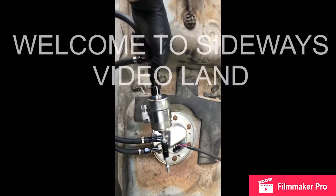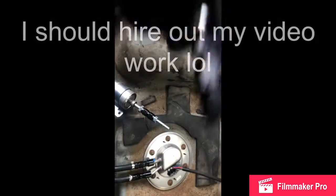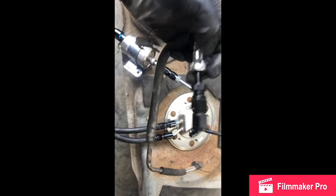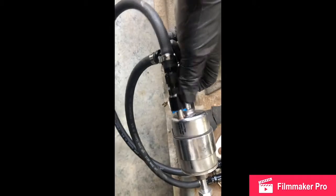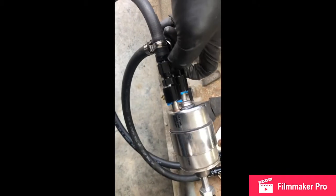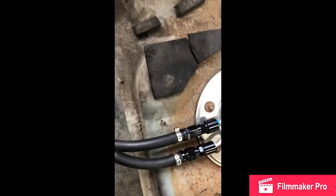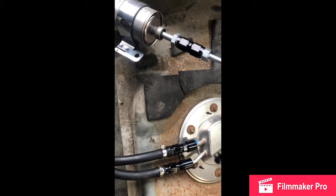Yeah, so this side with all the adapters on it, trying to use the stock fuel line, as you can see, it makes it like 3-4 inches longer. It wasn't going to work. It was just putting everything in too much of a bind in the car. So I just went ahead and made another little -6 line to plug in here. It's 3/8 with a -6 female to male push lock fitting. Clamps again. Same over here on your feed side, 3/8 -6 -6.